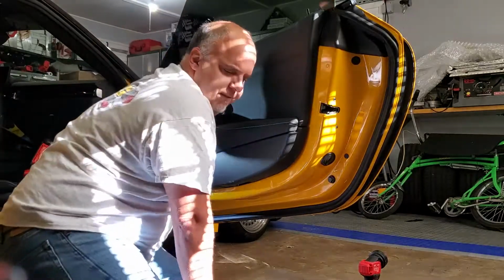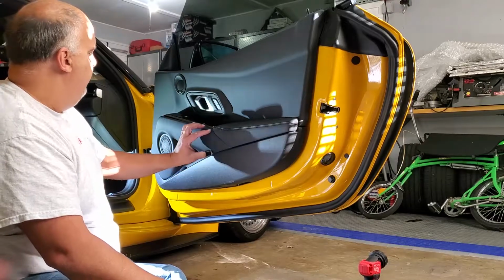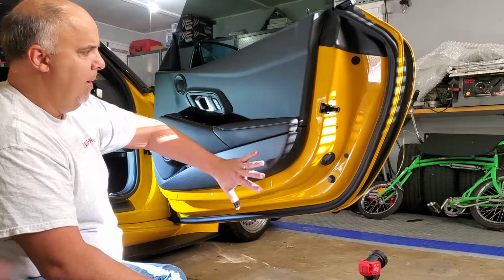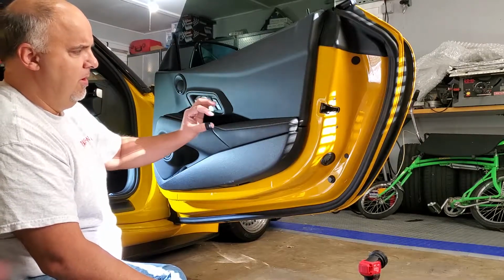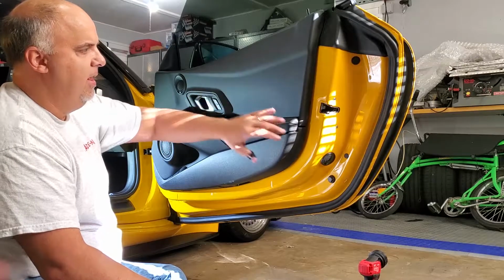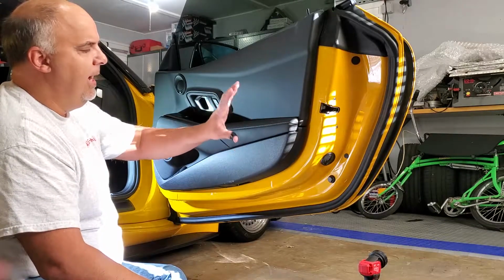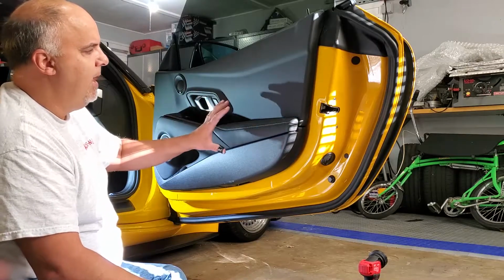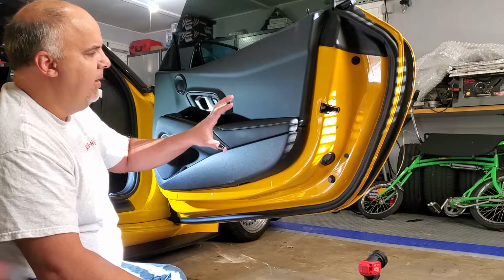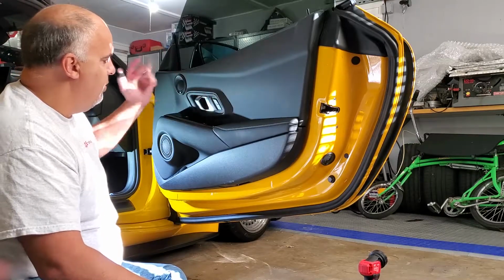The only thing left on the doors is when it goes to the stereo shop, we take the door panel off. After this gets modified on the inside of the plastic door panel here, we're probably going to put some closed-cell foam, which is a spongy foam that'll keep rattles from happening between the plastic of this and the metal, and it'll be one big sheet. And I can do it, or the shop's gonna do it. That will just help with a lot of rattles in the door, and that stuff does absorb some sound, but it's mostly for padding and rattles. But that can't be done until we get done modifying this. So there's a screw here and these two screws when you're finally done.